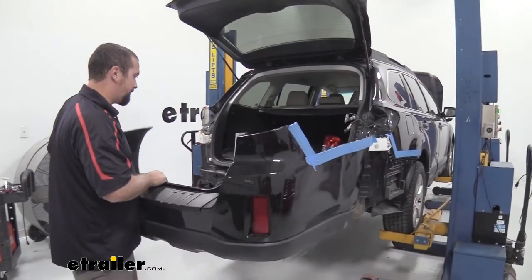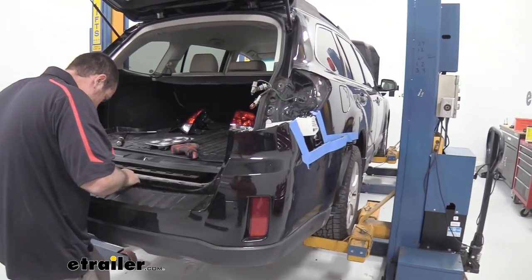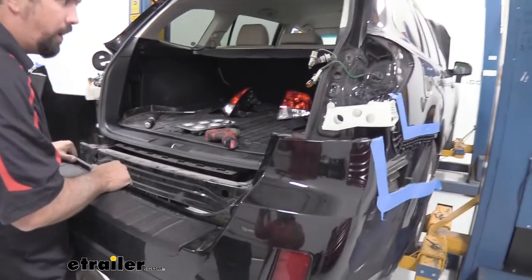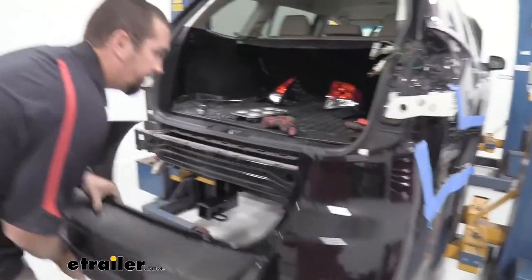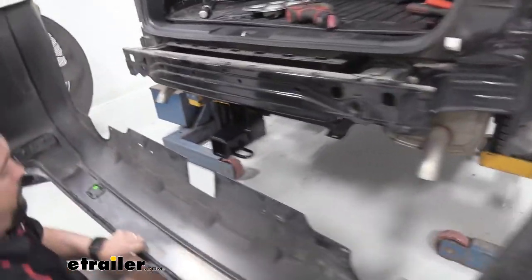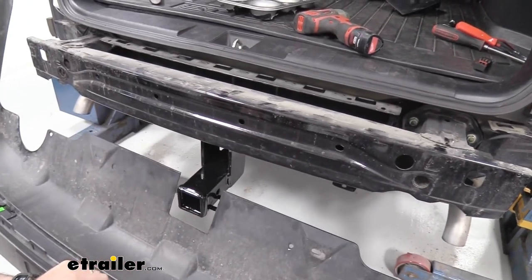After cutting, be careful as the plastic can get pretty hot. Once it cools down, break off the big pieces and take a file to smooth everything out — this step is worth taking your time on since it will live on the outside of your vehicle. Mock this up and make sure it does clear; it looks wide enough, so it looks like we'll be okay.